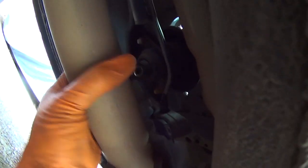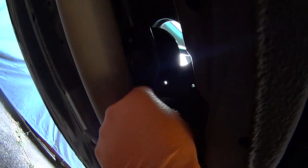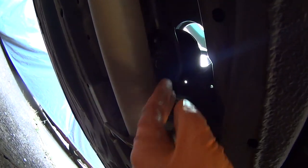This rod is connected to this joint right here, through this that connects through it, so that makes sense for these two holes. Once you take that off, it drops away. Then you'll want to take two bolts away from the bushing right here — these are two 12s, you take those out. Everything's been 12 so far. And then there's two 10s that are actually holding in your shifter; you take these out and the old puppy should come out.